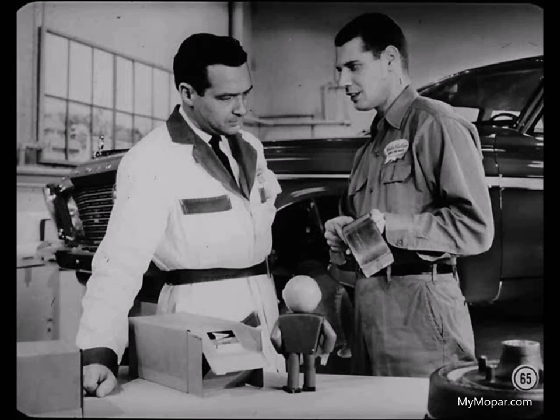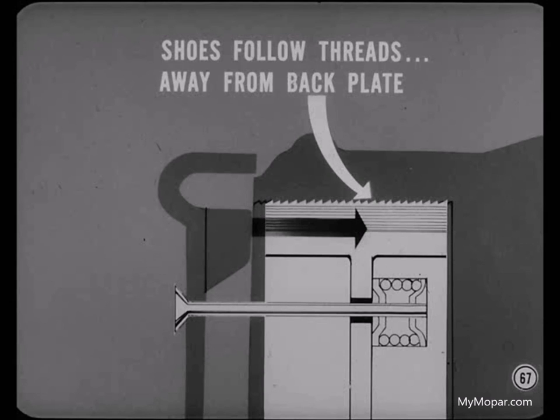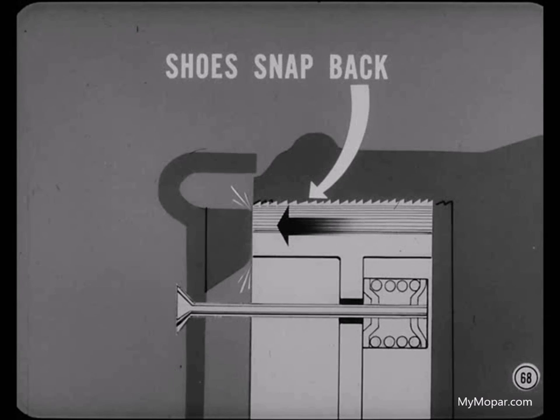I've heard that machining marks in a brake drum surface can cause an unusual knocking noise when the brakes are applied. I don't see how tool marks can cause a knocking noise. Sometimes a drum finishing tool cuts a thread into the face of the drum. When the brakes are applied, the shoes tend to follow the threads like a bolt being screwed onto a nut. The shoe actually moves away from the backing plate, and then the shoe hold-down springs snap the shoes back against the backing plate with a knocking noise.